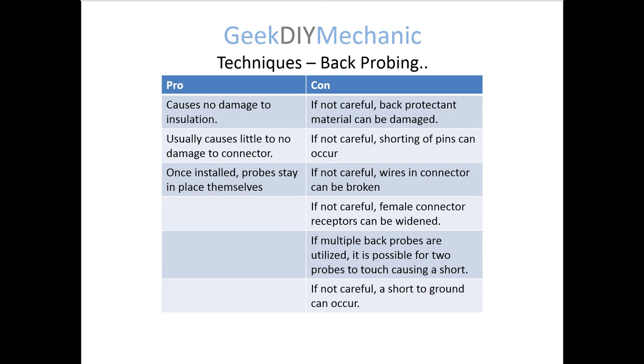If you're using multiple back probes — which I suggest you not do — it is possible for two T-pins to touch each other and short. For example, five-volt reference to ground is not a good thing — you just took down your five-volt reference circuit. Even if you're using one back probe, if your T-pin or probe touches the frame and you happen to be on the power side — five-volt reference — you will short that circuit. Be careful, take your time, and make sure you don't short anything. That's why I tend to use the probe connectors with the handle, because they tend not to. But sometimes you have to use T-pins — just take your time and watch what you're doing.